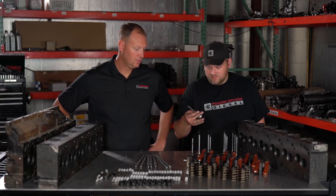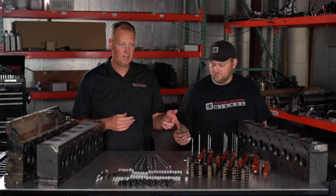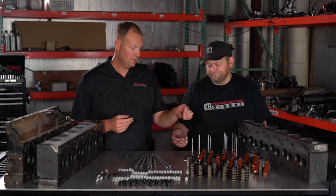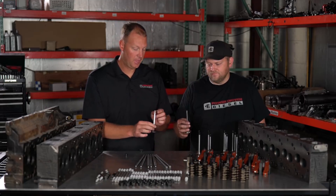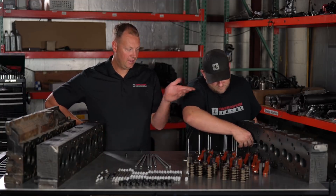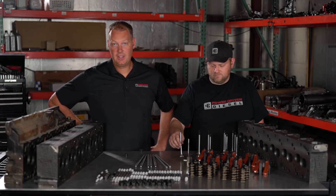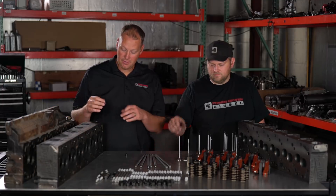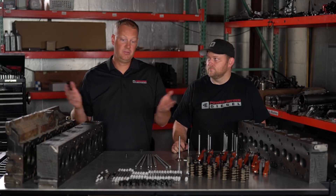The required diameter is 11/32nds to get the height. For those who like numbers, 11/32nds is 0.341 inches; 8mm is 0.314 inches — that's a fun little backwards number. There are no valves that will fit this head as readily made. You're going to have to have your head reamed out, your valve guides opened up to 11/32nds — otherwise there's no valve out there for you. It just doesn't exist.